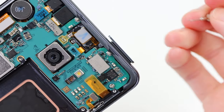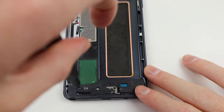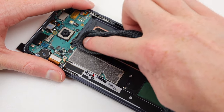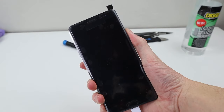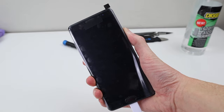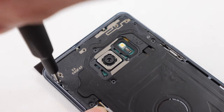This piece just helps stop the SIM eject tool going too far inside the phone, and it also has a little grommet which helps with the water resistance. With the phone taking shape we can install the speaker assembly and its screws. I'll give the battery compartment a clean out as it looked quite dirty, then put in the original 3200 mAh battery and test the phone. The phone is now charging and shows no low temperature warning — the issue was literally just caused by a faulty charging port.